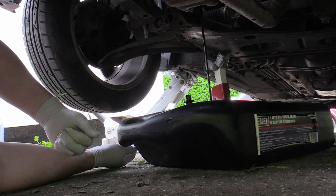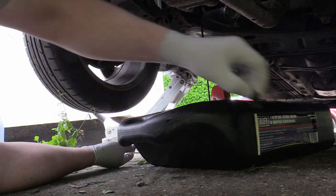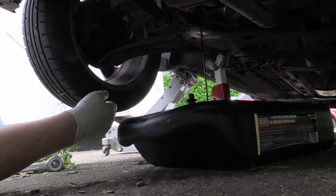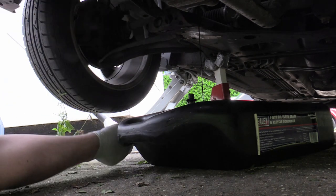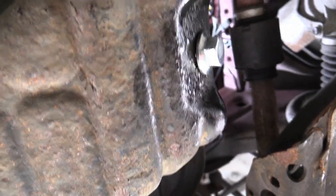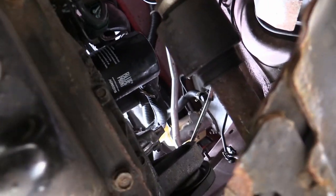The whole car only takes about four litres of oil and this is a 10-litre oil catch can, so you've got plenty of room. Throw that old one away, get the new one and put the new sump plug back in — you don't really have to do it tight, just enough to squash that copper washer. Now the new sump plug is in — give the area a bit of a wipe because it'll be covered in oil.